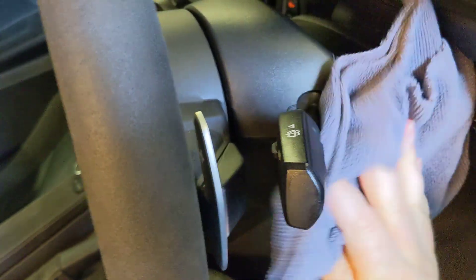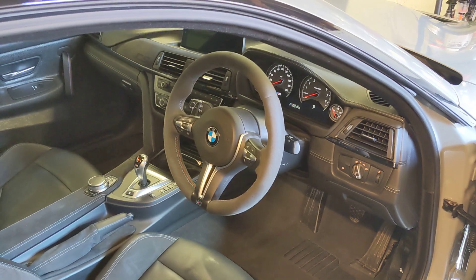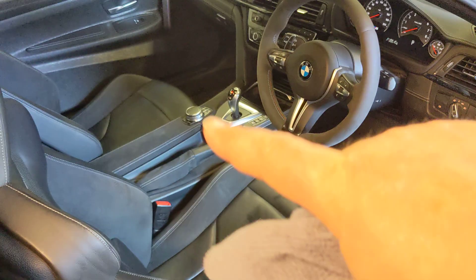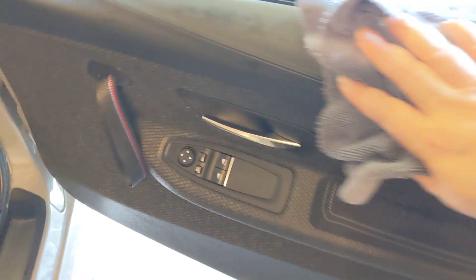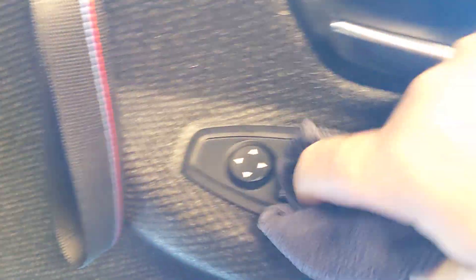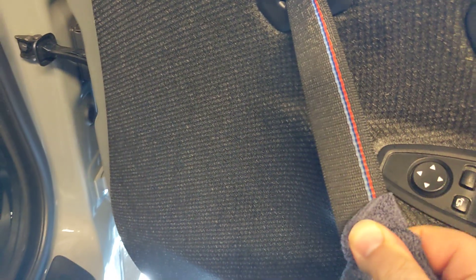Even when I go in on the Golf, it's very rarely that I'm filling an interior up with foam. I don't understand covering the dashboards in foam — all around there, covering it in foam. No. If you're doing that, you are just going to be leaving material in the car and you don't need to. Wet towel, dry towel — the wet just gets all of the stuff off there. Always give the buttons a little rub because you can get a bit of skin on them. All the things you grab hold of, you just want to give them a little wipe over to get that grease off them.